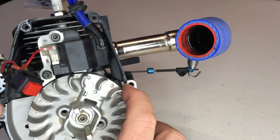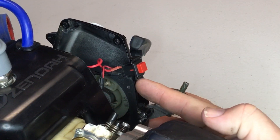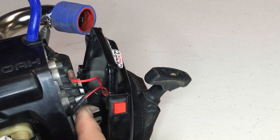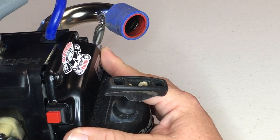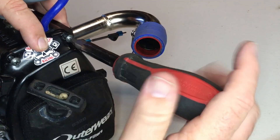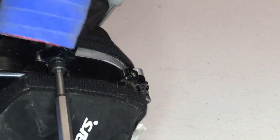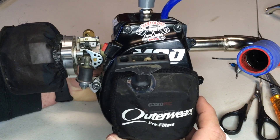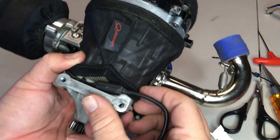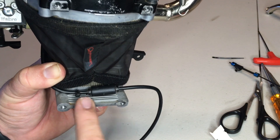Make sure that the tabs are in the slots, and replace the fan cover. Stick the kill switch into the fan cover as shown, with the tabs up and down vertically — this gives clearance to the coil wire. Make sure your wires are up and out of the way of the fan. Now replace the screws. With all screws installed on the fan shroud, the wire is routed underneath the carburetor and secured to the front mount plate with the provided zip tie. You may also secure it to one of the fins on your crank case vent.